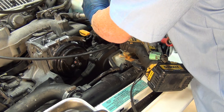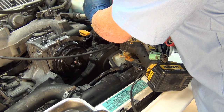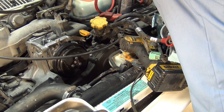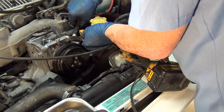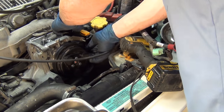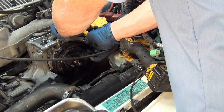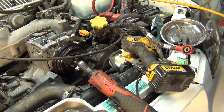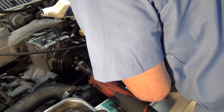I like to add oil to the low side hose before evacuating. If you put the oil in your manifold hose, you're just going to be sucking a bunch of humidity and air into the system. This way you've got oil right on deck in the low hose going in. Just spill a little bit and get it to follow down the O-ring. I don't smear it with my finger like I would with most things, because this stuff has to stay clean. Wiggle it until the bolt lines up — try to have that be as neutral as possible and let the bolt hold up. Good defense for leaks. With the oil it's going to drizzle into the high side as well.